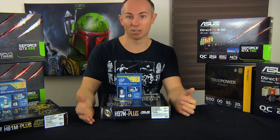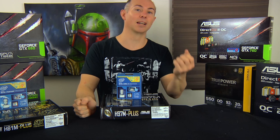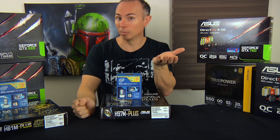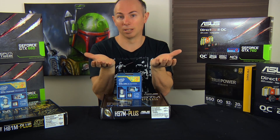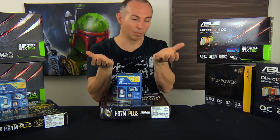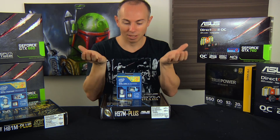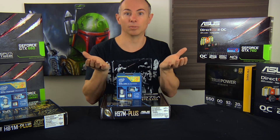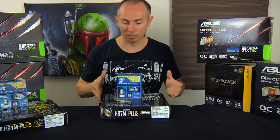I'm a massive fan of Intel solid state drives or any solid state drive. I would strongly recommend having a solid state drive as your system drive and to put some games on it, then have a one, two, or three terabyte hard drive as your data drive. Put your main couple of games on the SSD and put all your other games on the mechanical drive. Seagate three terabyte hard drives have quite good performance — the one and two terabytes not so much; three terabytes is where they start getting better performance.